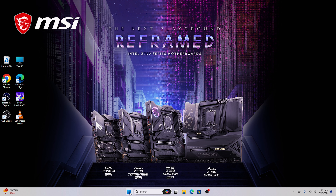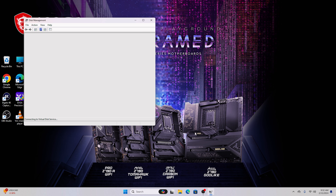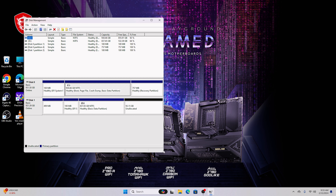This is now Windows 11 on my Dark Dragon build. The drive lights up when connected. Go to Disk Management — I have two drives in this system. Drive C is the one we do not want. The other drive shows 93 gigabytes of unallocated space, which is for over-provisioning through Samsung Magician software. That's Disk 1, showing as D drive.